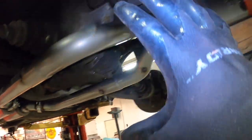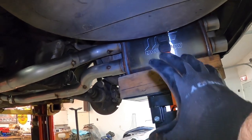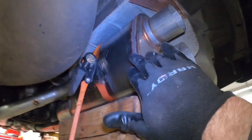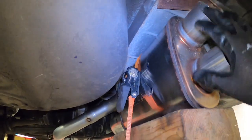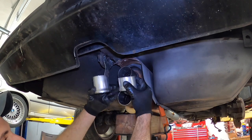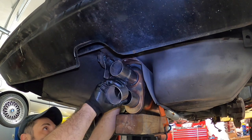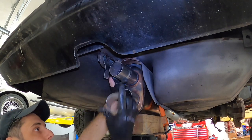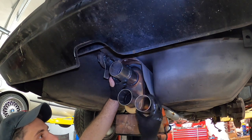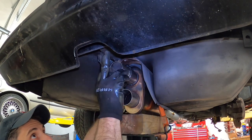We have the muffler hanging in space now. The only hangers we have are here and here, and with the added weight of this muffler if I let this down right now it'll sink lower than what I want. So what I need to do is weld another bracket on top that connects to this muffler. With the top and bottom outputs, I made two flare pieces — one's going to go on the top, the longer one, so I can have my exhaust hanger hang from it. The bottom one is smaller; I'm going to be cutting this part of the muffler back and then welding this on.